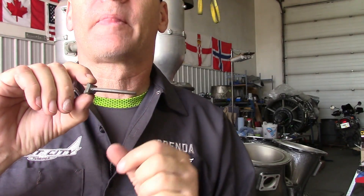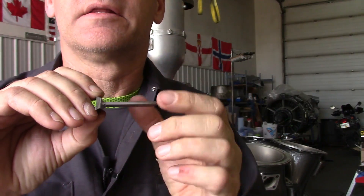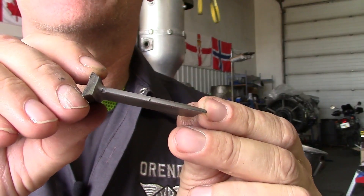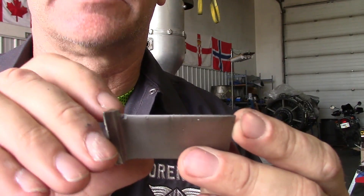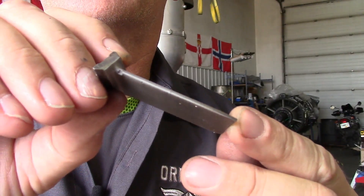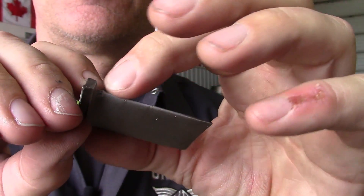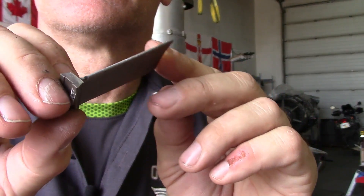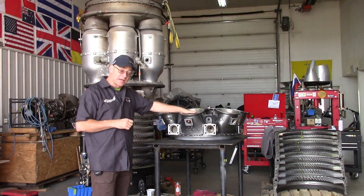This is the platform that mounts to the case of the engine — outer — and this is the leading edge. Right at the base of support, right next to it, there is what we would call a very large stress concentration — a nick. You see that? That's not fixable, that's too close to the base. Anything in the bottom third is rejected. A lot of the blades look like that — this is garbage. If you blended that you would narrow the base and it would wobble and eventually snap off and cause all kinds of bad damage.